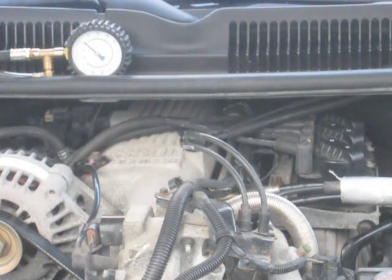I'm going to check something. I'm going to turn the car on, let it idle, and check the pressure. If I take the vacuum line off of the regulator, pressure should raise — because vacuum is actually pulling the spring inside of it away from the diaphragm, opening up the line. If I take the vacuum away, the spring should expand, pushing the diaphragm into the fuel regulator and closing off the fuel, allowing fuel pressure to raise. Vacuum is at its greatest when the car is at idle, so if I pull the vacuum line off the regulator, pressure should raise. Let's see what happens.